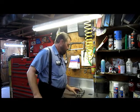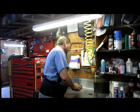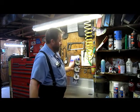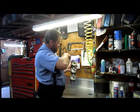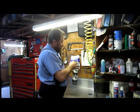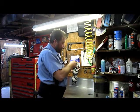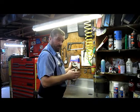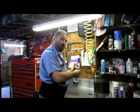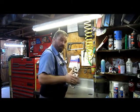For you guys that are just doing your own carburetor rebuild, this is very important. If you haven't disturbed these screws at all, take your key and put it into position — you can see it's at the twelve o'clock position. We count our clockwise turns in and count how many turns it takes to seat the screw. That way we know how many turns to back it out. Once you've seated the screw and counted the turns, write that down — five turns, six turns, whatever. When you reassemble, tighten your screw all the way in until it seats, and back it out that same number of turns. More than likely, your idle will be right around where it's supposed to be.